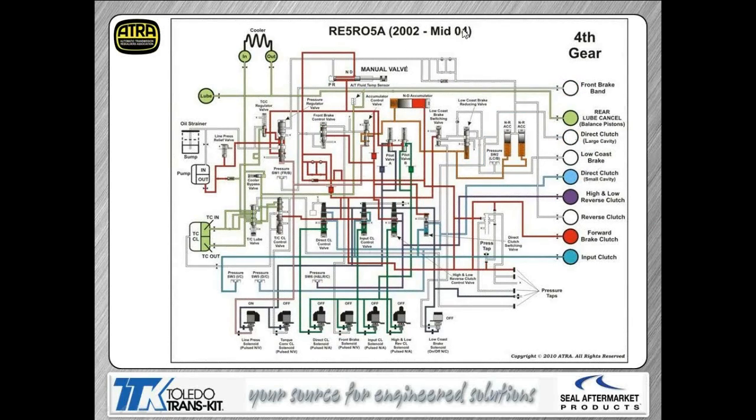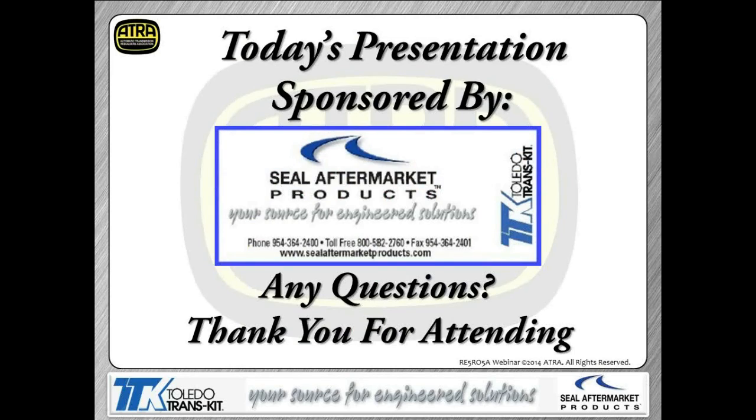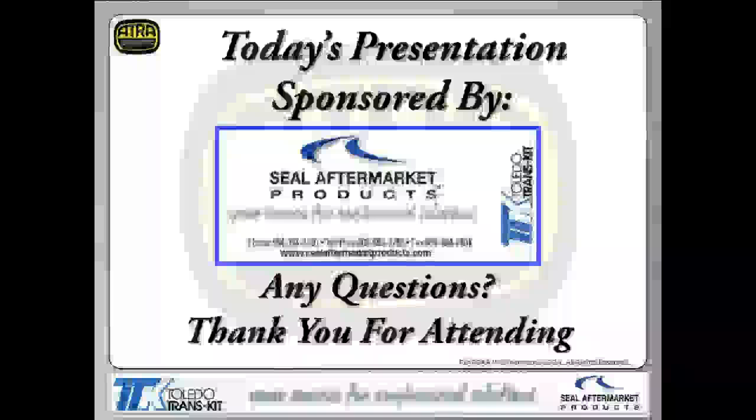Like the idle air volume learning, you have to make sure your battery voltage is up to where it's supposed to be. Engine coolant has to be at operating temperature. Park neutral switch has to be working. Vehicle has to be stopped. Transmission operating temperature has to be also at the right temperature before doing anything like this. One of the things I want to mention here is that the electric loads have to be off. Any loads like for AC, headlamps, rear window defoggers, things like that.